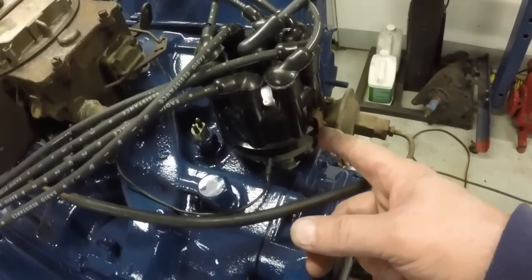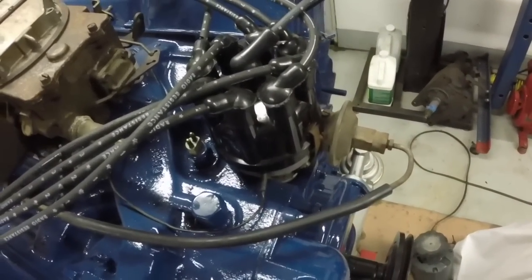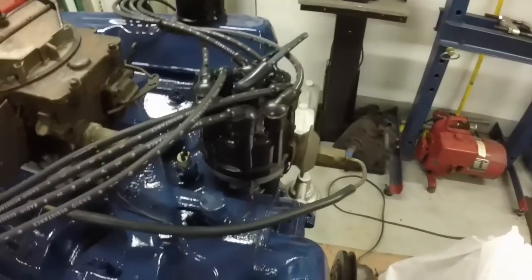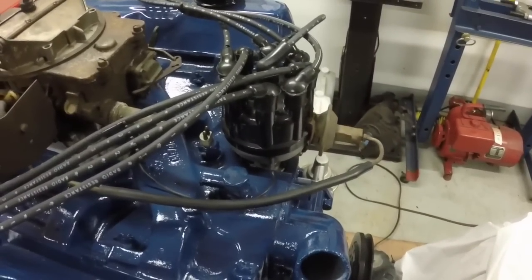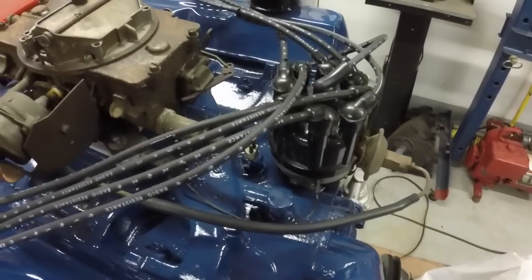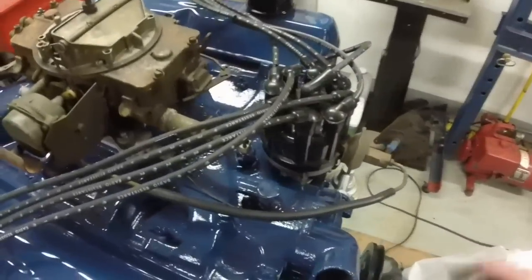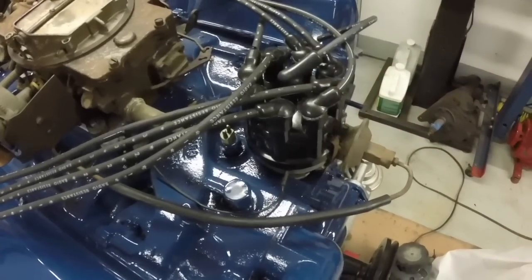These little bales for the distributor cap I'll take off and repaint — they're held on with a little cotter pin. I'm going to take the distributor out when I put the engine in, then fill the engine with oil, and run the oil pump with a drill motor before I put the distributor back in. That's why I haven't done anything with this yet — I'll replace all that when I have the distributor out.